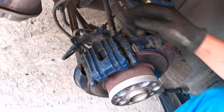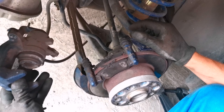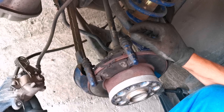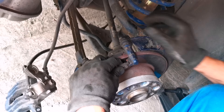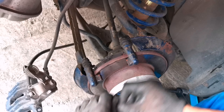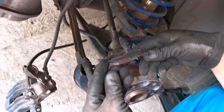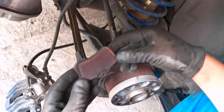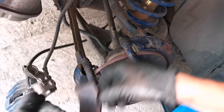And here is the second screw. Now what we have to do is to lift the caliper up. If yours is stuck, you can use a screwdriver to push from behind. So those are my brake pads and for sure they have seen better days — this one is destroyed, it's almost to the metal part, and this one seems to be in a very good condition.